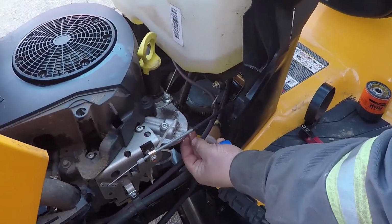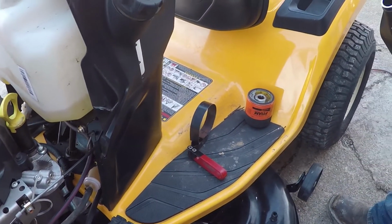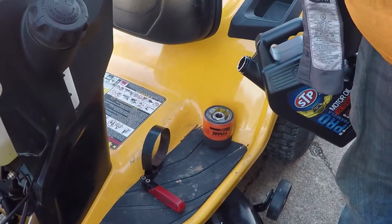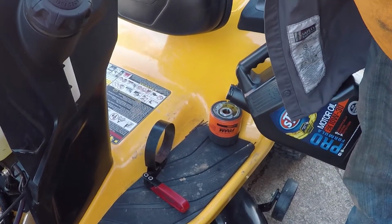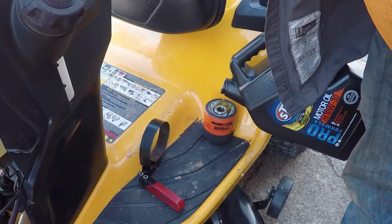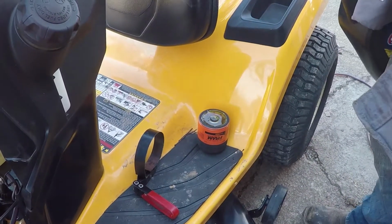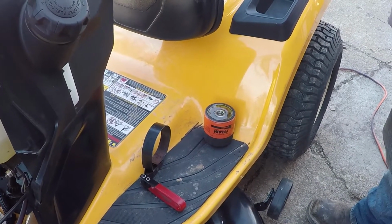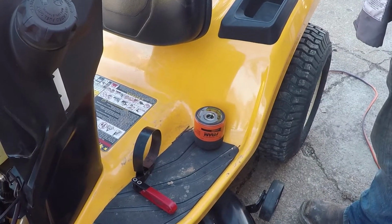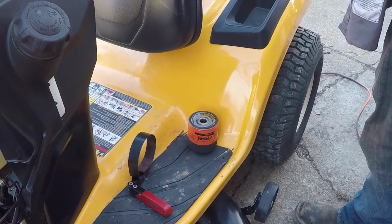That's drinking. I'll reach up in there. Make sure that the rubber gasket came off with the filter. Two rubber gaskets equals a pressure leak, and it will leak everywhere. Now, if you're using an extended filter, no matter what you're doing, you go by the book about how much oil you want to put in it, but also check your oil, and you want to check it regularly anyway. There's still oil coming out of that spigot.